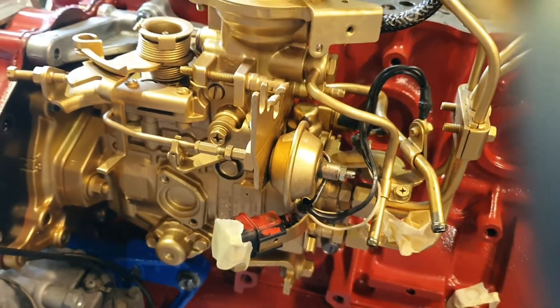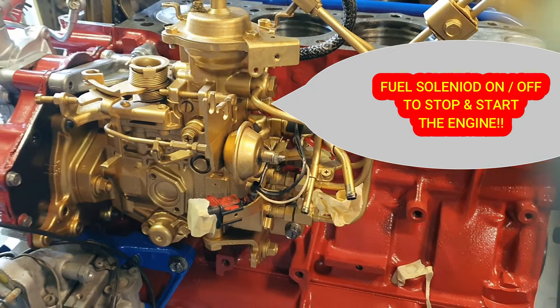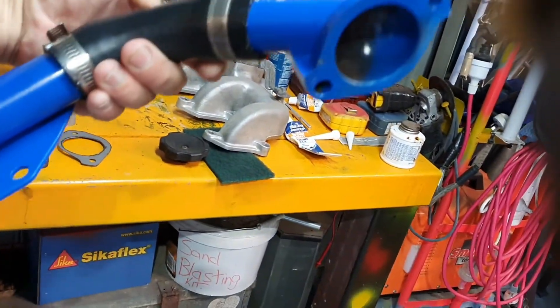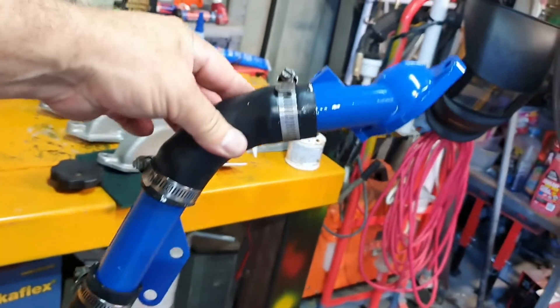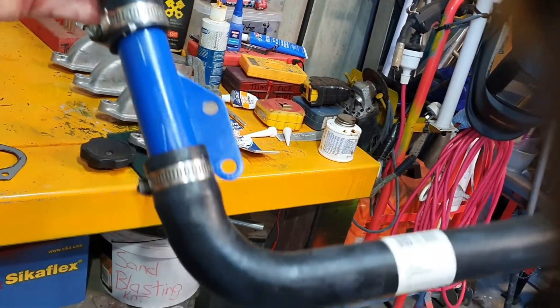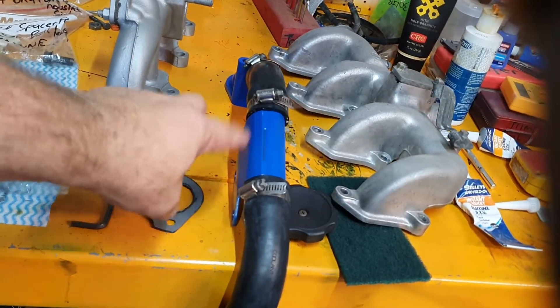A pump that might need to rebuild, I don't know. But I've cleaned what I can pretty much in and out. Grease what I could, check bearings, there's no seized parts. Here's the thermostat, rest of the thermostat housing. New rubber pipes — this was actually off a VT Holden Commodore. Cut down 30 bucks compared to 70 for two near-genuine Pajero pipes. Happy about that — cleaned those pipes out inside as well, the rust.